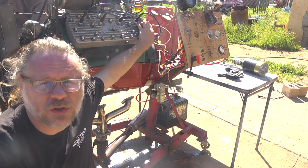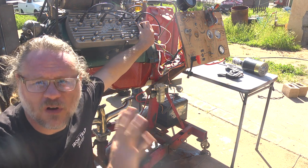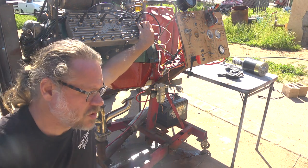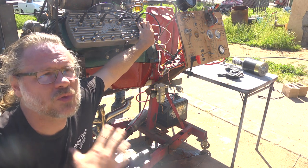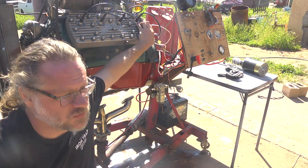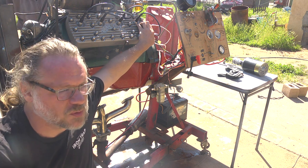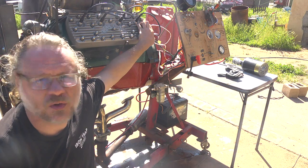As you saw it, we turned it and it went - meh. And then the starter kicked out and stopped - which was the engine hydro locking. Fortunately it didn't kick off. Cause if it kicked off, it would have just exploded the piston and everything.